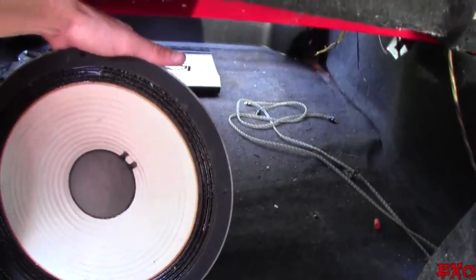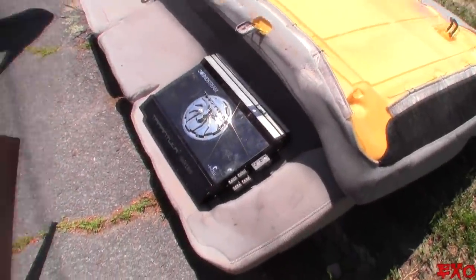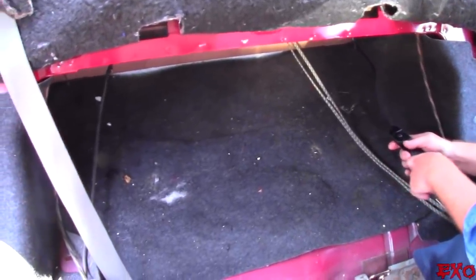Is this a 12-inch speaker I'm holding? You could probably fit 15s in there. Here comes the power and ground, and then RCAs. You're doing two 15s in here for real? That's going to be awesome — probably Soundcube HDS. I'm hoping I have enough airspace, because most 15s take three to five cubic feet to be happy. A cramped space like this is going to make matters very difficult when designing and building. But luckily we don't have to worry about that today — we're just getting the mids and highs up and running.